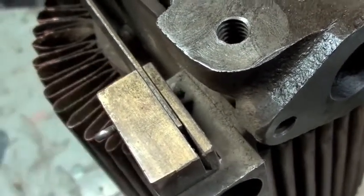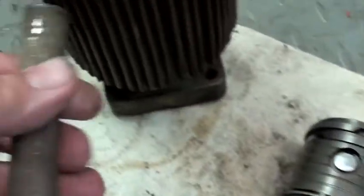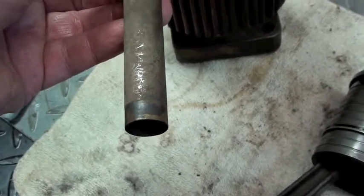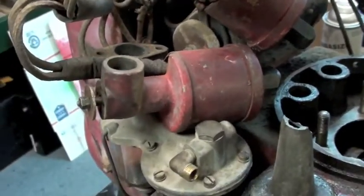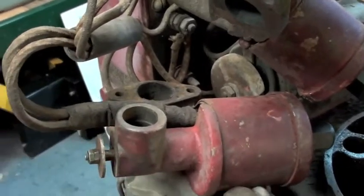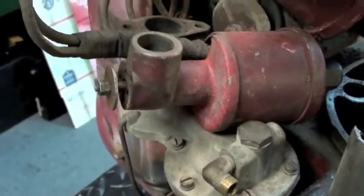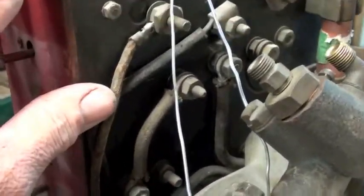When it's colder it'll close off like that. This tube sticks in here and comes over to the carburetor and carries the fresh air intake. I've got the engine partially disassembled and I didn't want to disconnect the wires yet, so I've just laid this solenoid assembly on top of the fuel pump here, just to not stretch the wires. I really don't want to disturb any of this until I get the engine running and see what it's like electrically.